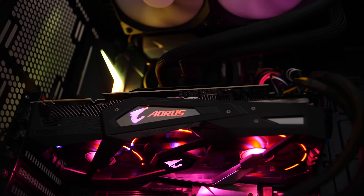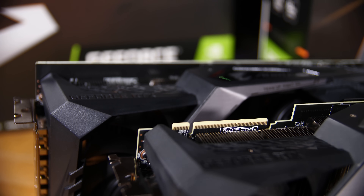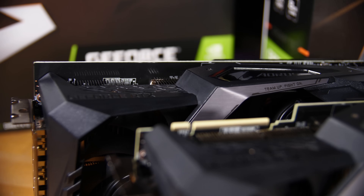There is actually one other difference with the 2080 and 2070: the 2080 has the NVLink SLI connector, whereas the 2070 doesn't. It's completely gone — it's now just a large obtrusive PCB sticking out the side. It's not entirely surprising that NVIDIA is locking out SLI on the lower-tier cards, and it's now just physically not possible on the 2070s.